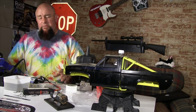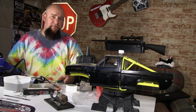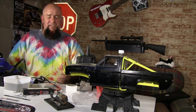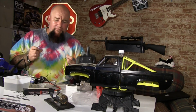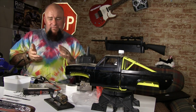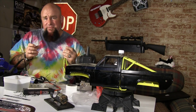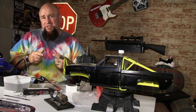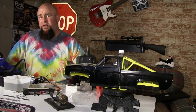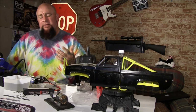Spring prices vary. When you buy springs, you can do some research and study on that because they've got different stiffness rates on the springs. Some people prefer a softer spring, some people prefer a stiffer. The softer ones, of course, aren't going to push the brush on the comm as hard. Your stiff springs are going to push it harder. The harder it pushes, the quicker it's going to wear down, of course, but it's also going to give you a little bit increase in your power, slightly more torque. The softer, you're going to lack a little power.